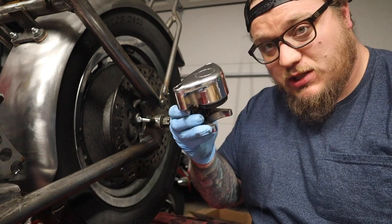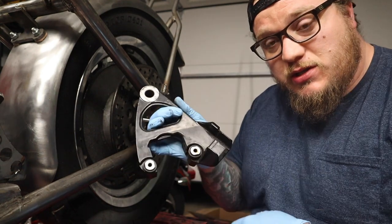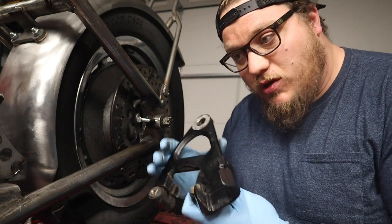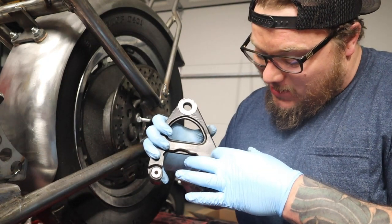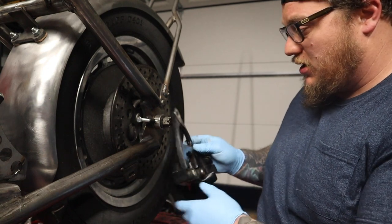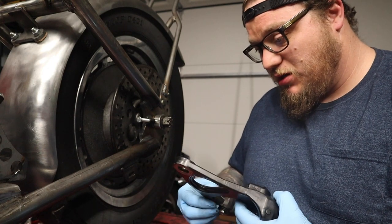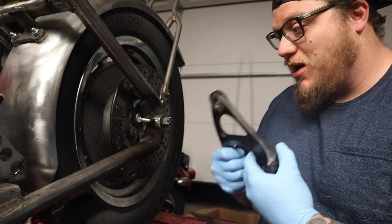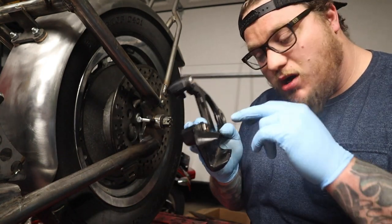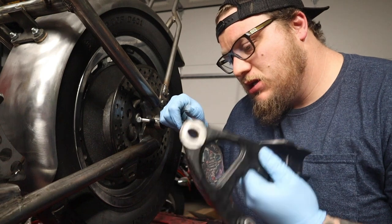Taking this caliper apart — that's the actual caliper and this is the mounting plate. The hole is going to get drilled and tapped somewhere in this area, so that means I have a whole lot of meat over here that I do not need. I'm going to take a cutoff wheel on my angle grinder and cut a line straight through here, get rid of this part that mounts on the old swingarm, because it's going to be sticking out and look terrible. I'll probably send this off to powder coat to match the frame. So — cut this whole chunk off, get it cleaned up, then drill, tap, and get this brake finally mounted the correct way.